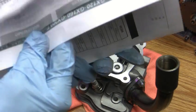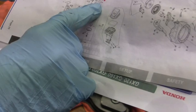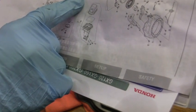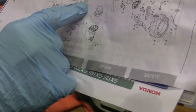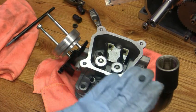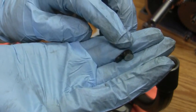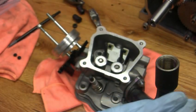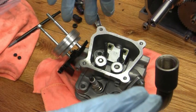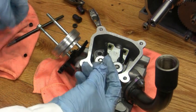Here's what I was doing - I was looking at this and I noticed that piece is missing. What they call it is the rotary - what you call them - the tappet caps. This one over here is the stock one, and that goes on the exhaust because the exhaust valve will not spin. Not only that, because of those crummy retainers it'll actually fall down through there if it doesn't turn. So I found out with these retainers you have to use two of these lash caps.